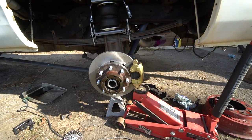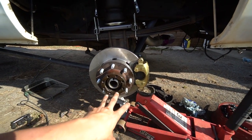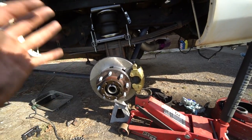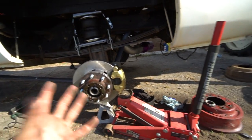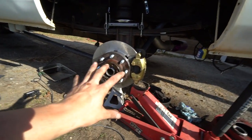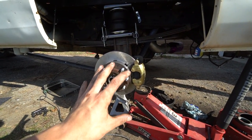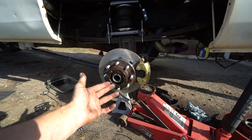Okay, so I have this roughly mounted up right now. Nothing is set in stone yet. I don't even have the axle nut in there. But basically, what you want to do is get your rotor on the back side of your hub and slide that on. You really want to put the axle nut on as well and tighten it up all the way, so you know that's where the hub and rotor is sitting,